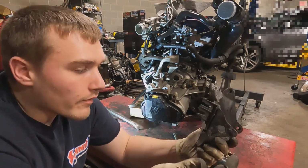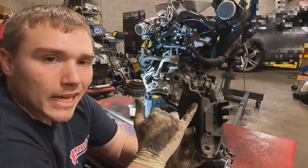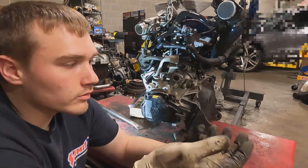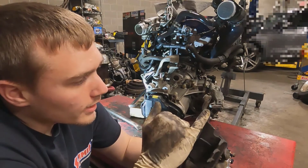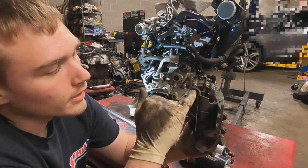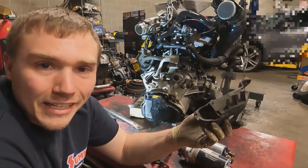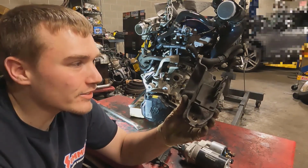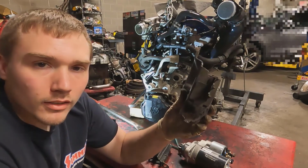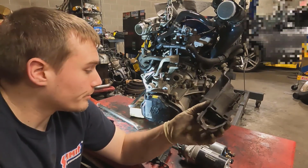But if it's a 2-liter, like mine is, there's usually a little bracket here. You can retain that if you bend it right to bolt on the coolant pipe that goes across, but I cut mine off just cause. Right here is where you have to grind. So you can see I took a little baby chunk out right here, and then ever so slightly it was grinding and grinding, and then it just cleared. I mean, not much more to it than that. You just grind the thing until it clears. It's stamped steel. You're taking off barely any. It's thick stuff. Don't worry about it. Don't spend $200 on a TDI mount, something that's pretty much obsolete at this point.